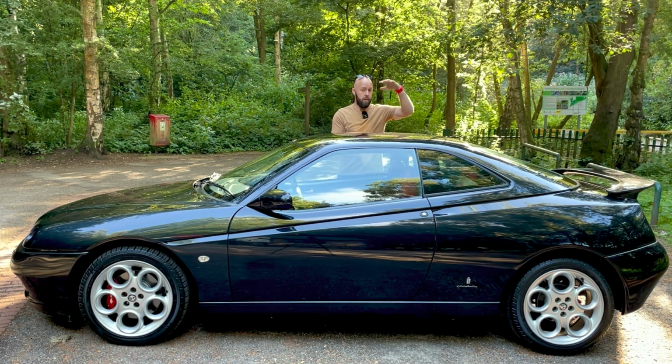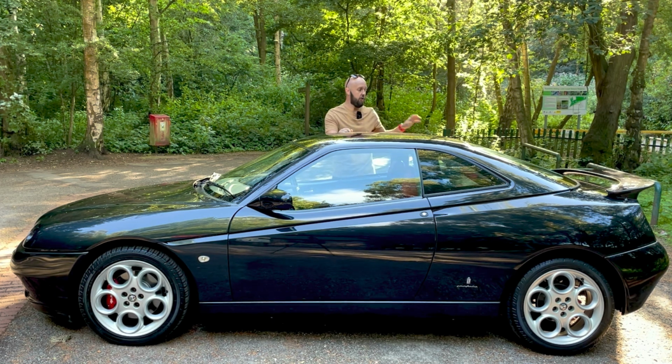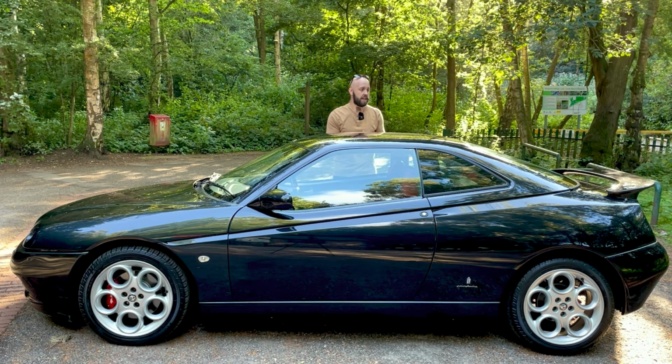Because there'll be a lot more give in the suspension, it should be a lot more compliant. But more importantly, I don't want it to rub in the rear anymore. Also, if you've been watching my previous episodes, you will have known that this was running 4 degrees negative camber, partly because of the rear springs. But now that should be reinstated back within factory spec, which is what, 2 degrees, is it? Something like that. But I'm going to find out about that in a later episode.